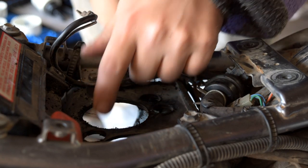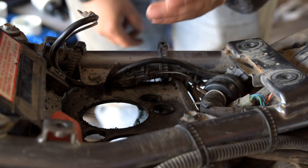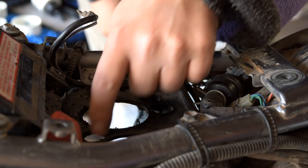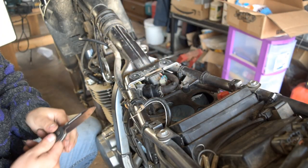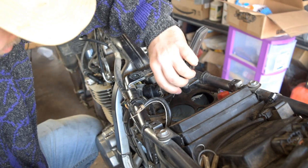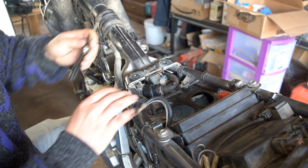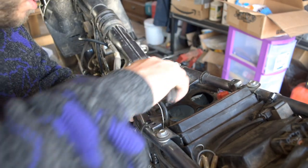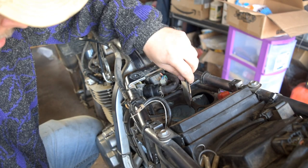Now what I can do is these holes are small enough that I can use some rubber grommets. So if I test out the bike and find it's just getting too much air for where I live or the setup here, I can just plug a couple of those holes. If I'm not getting enough fuel mileage and I want to switch back down to the 150 jet, I can plug one or two of these smaller holes until I get the combination right and the bike is running perfect. I kind of hold to the philosophy that no matter what you're doing, you do the very best job you can. You could just leave all these edges hanging loosely and ugly, but why not take a couple minutes and tidy it up - make it look nice and clean. It looks like you did good quality work and you're proud of the job you did.